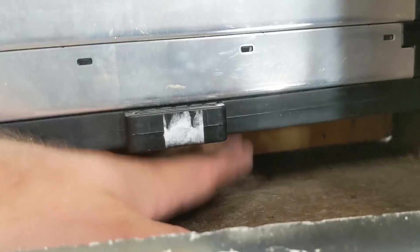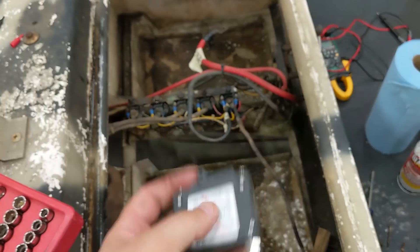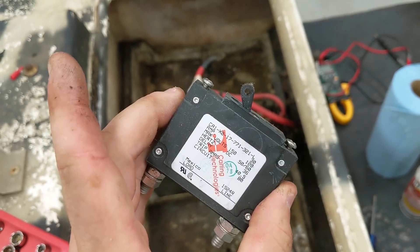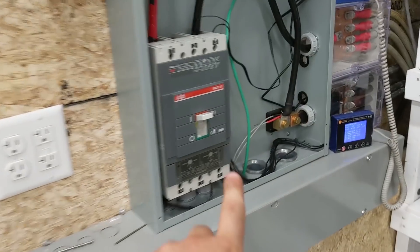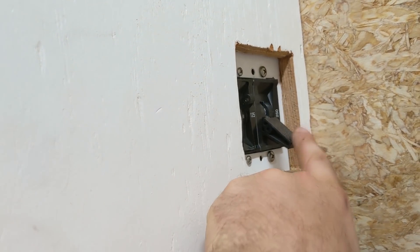Between the fiberglass and the battery, there's some distance over here as well. I need a big circuit breaker to handle the surge that motor is going to pull, and I don't know how many amps it's going to pull right off the bat. I have this one, but I think this is 30 amps, so this definitely won't be enough. What else have I got kicking around? Over here was my first DC load center, and I'm still using this circuit breaker for the Victron charge controller. But this other circuit breaker — this is a 250 amp — I'm not using that one anymore since I added this ABB breaker for my big battery bank. So this one is a spare right now, and I think I'm going to pull this out.